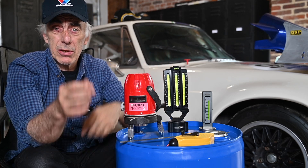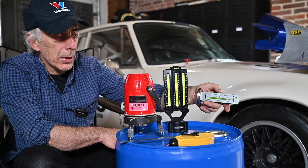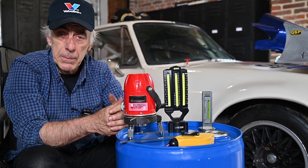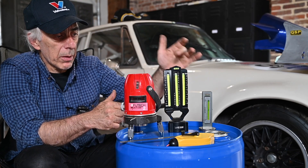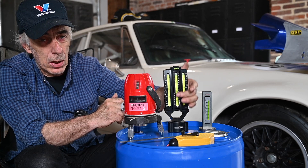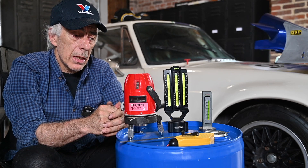If there is a delta between the two distances then you need to calculate what the angle is. If you want to work a bit faster and more efficiently, you might want to go for a camber gauge. Here is my camber gauge — it's magnetic, very handy. You just stick it to the wheel hub and you can read the camber right away. In the middle I have a professional camber gauge with negative and positive camber readings.